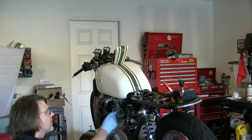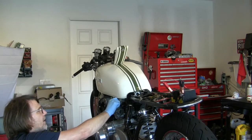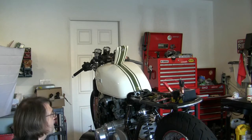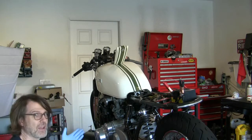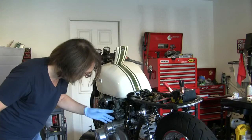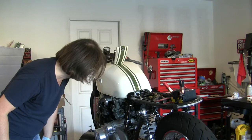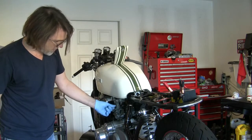And then, yeah, the vacuum line for the petcock, you can't access that with these filters on and the tank on and all that. You need those hoses in place first, then the tank goes on. So, did all that off camera, sorry, but got it on. Fuel's hooked up, we're not leaking. I'm going to have to touch up some paint on the engine here because I did spill some fuel. So we should be ready to run like this.